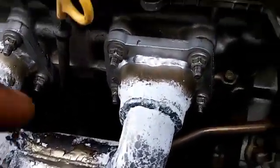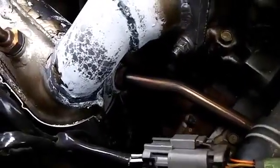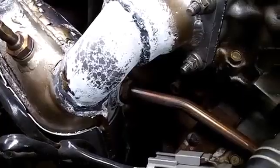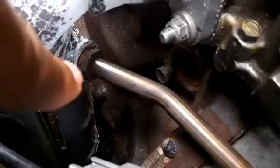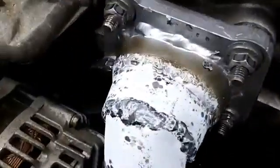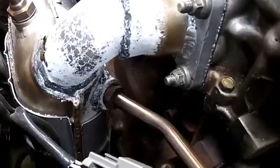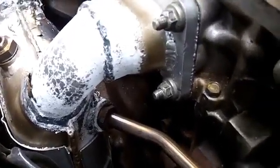So the problem was, if I screw these up here and screw these too tight, the ones on the bottom, I can't line it up to get into the hole to be able to put the bolts on. But then if I loosen these at the top and put those on the bottom, then I can't put this air tube screw on. But then if I put the air screw too tight on, then the ones at the bottom I can't line up. But then if I can't screw these in, then I got a big gap and the exhaust is gonna leak through. So I really just had to keep going back and forth between the top two, the air tube, and the bottom, in order to get a good line up to screw everything in.